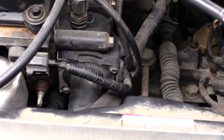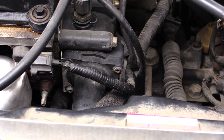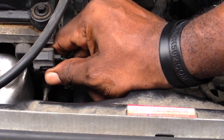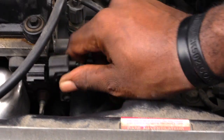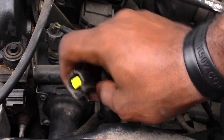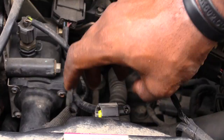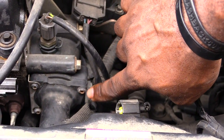What's going on folks, I'm about to show you how to change out a thermostat on a 2000 Escort. The first thing you want to do is disconnect this electrical right here — this cord right here will pop out. Move it out the way, and once you do that you should be able to see the three bolts or screws you want to take out.